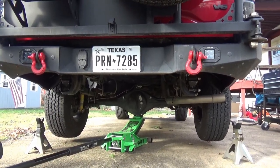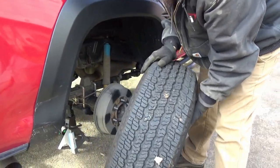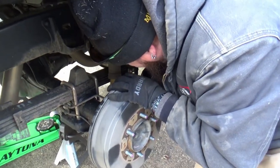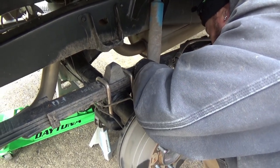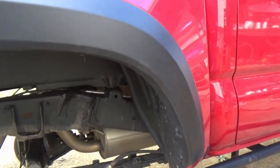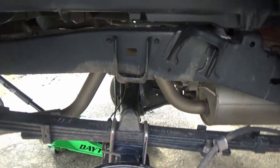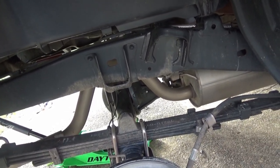Up, Mr. Truck — I'm sure it's nice and light with this rear bumper. Thankfully we don't have gas. Starting with the passenger side, removing the old shocks. We let the jack stay where it was, supporting the pumpkin, and moved the jack stands up. Now the weight of the pumpkin is supported by the jack. We're going to remove the U-bolts and bump stops, then lower the jack to drop the pumpkin from the leaf springs so we can take the leafs apart and remove the center pin to install the add-a-leaf.